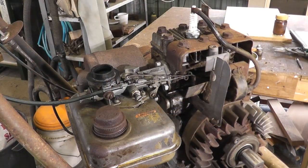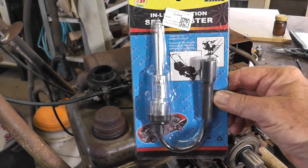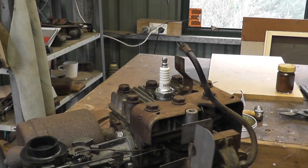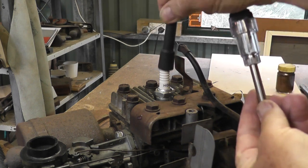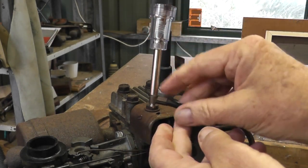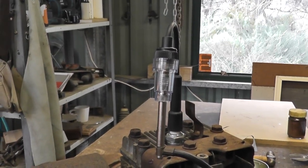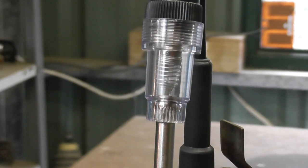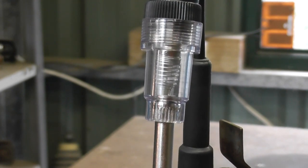At the beginning of the video I showed how to test the spark without a spark tester, but I've originally purchased one of these. I've had to redub this audio because it was so windy the shed door was rattling and drowning out what I said. Basically you connect this to the spark plug lead and then to the spark plug itself, and when you turn the engine over you get a small light — that little light bulb in there lights up. It's a really good way to test the spark without having to take the spark plug out, because some are quite difficult to get to.